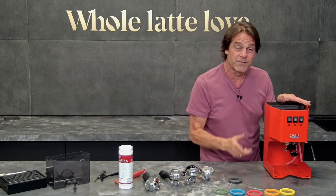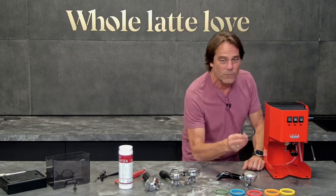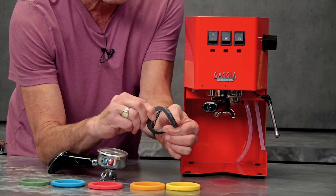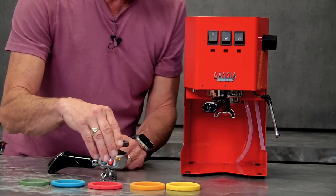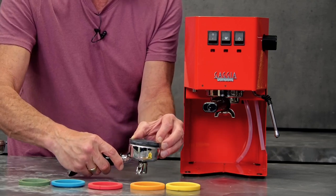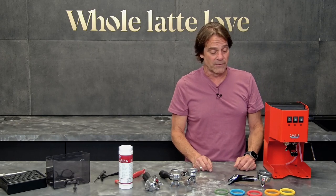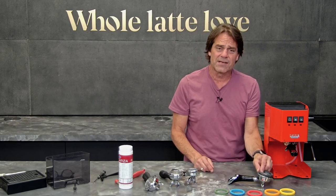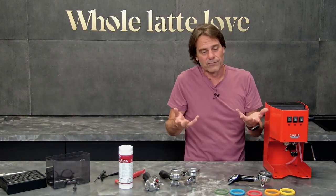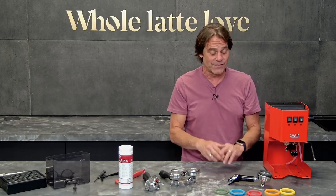It's perfectly common in a new machine that you're going to underclock maybe a little bit when you first get it. Not always the case, but it happens sometimes. Why does that happen? Because what you're clocking in against is a group gasket that looks like this. This is a relatively stiff piece of rubber. What you're doing is cranking the portafilter up against that and trying to compress it a little bit. Over time, those are going to break in a little bit — you're going to get a small channel in here. When the rubber is cold, it's going to be harder; warm it up and it's going to give a little bit more.